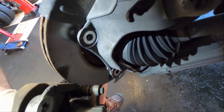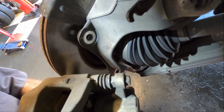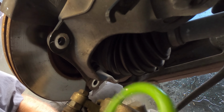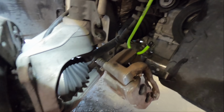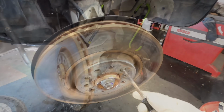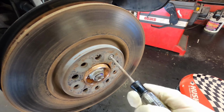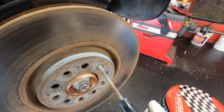Okay, and I'll unplug this from here. All right, this guy, I'm just gonna hang it from a brake line bracket using my hanger devices, and then this caliper will be tucked out of the way until later on. That'll be the last thing to go on, I think. Okay, it looks like I'm reusing this rotor. And yeah, that was actually that loose. I didn't think I was going to be able to get that with this tool.